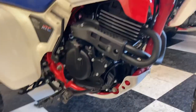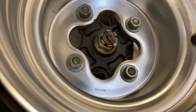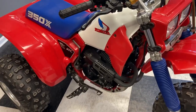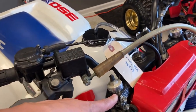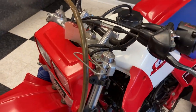The '86 has milled centers — you can see same front and rear — and this is unique to 1986 ATC 350Xs. Hub colors: on the '86 it's black and black; the '85 is a darker charcoal — it's hard to see in the shadow but it's more of a charcoal color, almost the same color as an '86 ATC 250X engine, same thing on the front. Both have the same headlights. The upper fork tree on the '86 is black; on the '85 it's polished — so that's a difference as well.